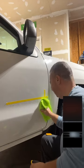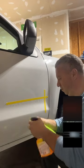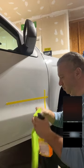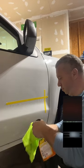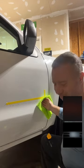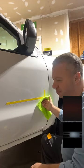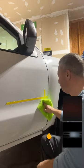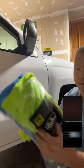Yeah, and I was talking to Jonathan at Dirty to Dreamy, and he was talking about using the high alkali cleaners from Bridgepoint, which are the fire and ice on mats. He makes a comment that you want to make sure you're using a white terry cloth when you do that, because with microfiber, especially some of the cheaper ones, the alkali can release the color in the microfiber and actually transfer the color onto your carpet. And if it locks, you just ruin that carpet.